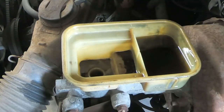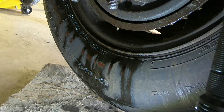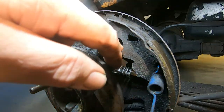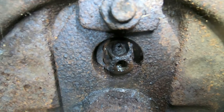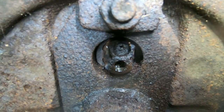When I went ahead and removed the cap to the master cylinder, I discovered that the front reservoir was empty. This means that the problem was in the back. It didn't take long to discover that brake fluid was pouring out of the right rear drum. The cause of this was the wheel cylinder somehow lost contact with the brake shoe. With no resistance, the piston just blew right out. What had happened is the area of the backup plate that holds the wheel cylinder in place has rusted through, leaving the wheel cylinder quite loose - and that's why it slipped out of position.